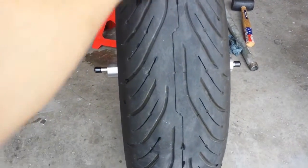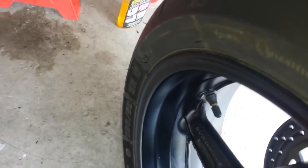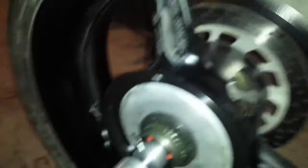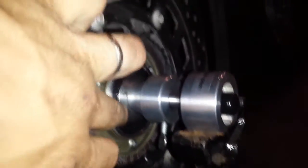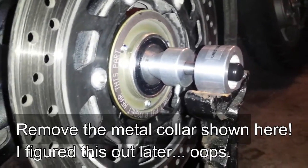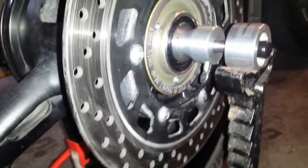Okay, so now I've got my balancer ready to go. I'm going to take a pair of jack stands and raise each of them all the way up. Here is the tire set up on the jack stands on the balancer tool. You need to make sure your cones are snug — this metal piece that goes into the bearings on your FJR, you don't want that to come loose. It's just loosely sitting in here; it needs to be tight. So do that before you put it on the jack stands. Get those cones snugged down.